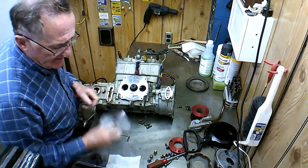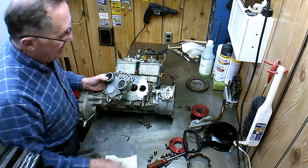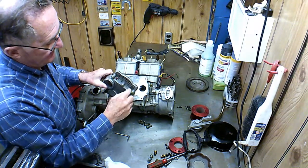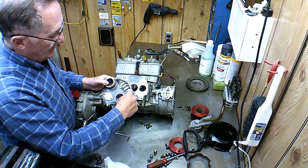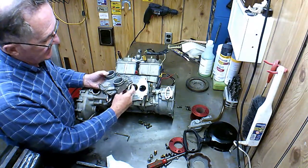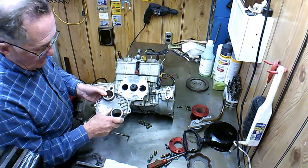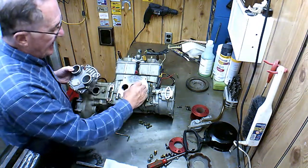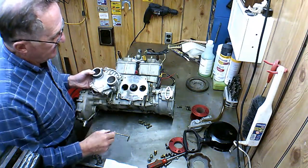But I did want to tell you about the oil pump on this engine and the reason I removed it. This is the reason for this modification. You'll notice the oil injection lines here. I got little pieces of plastic, like sealed off tubing, that close these oil injector lines where the oil was being pumped into the engine at one time. And the oil pump was removed, which under this cover, if you take these screws out, there was a plastic gear on that side of it that engaged the end of this spline right here. They're using this spline like a gear to drive the oil pump.